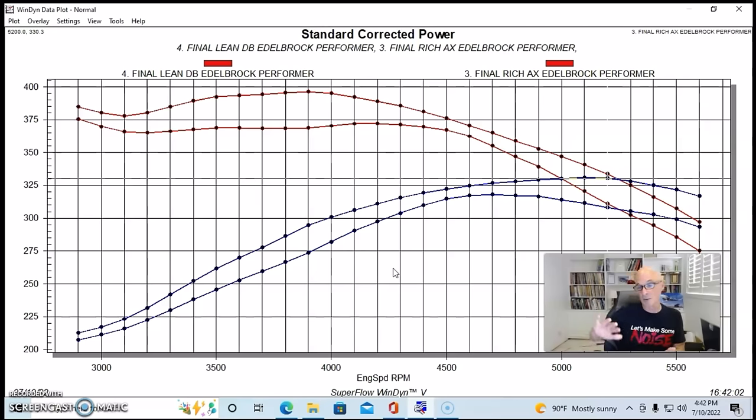Okay, guys, what's the takeaway on all the testing on our 400-inch Pontiac motor? First of all, Quadrajets, yeah, they work awesome, and they obviously make very good power. As we saw in part one, it's much better than a two-barrel because it's a four-barrel. It also made as much power as the 750 Quick Fuel carburetor, and in this test, it did very well even on our cast iron Quadrajet manifold, which, by the way, made more power than the aluminum Edelbrock combination. Also, tuning is very important on the Quadrajet. As we saw, having the air fuel mixture right on the Quadrajet made pretty good power gains, and make sure to keep that oil level up on your Pontiac.